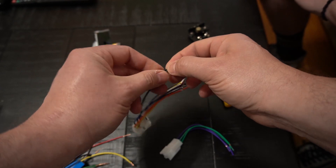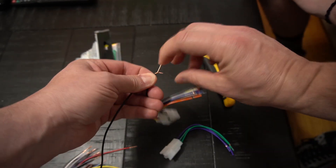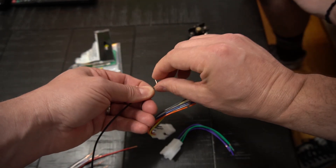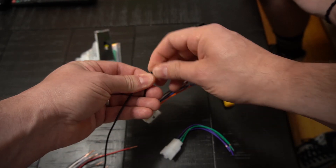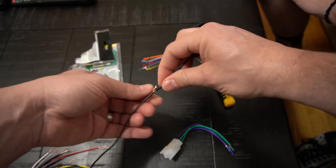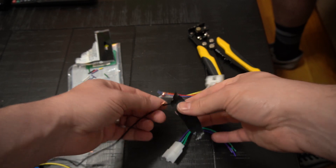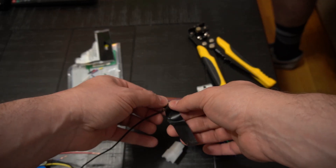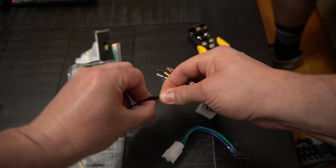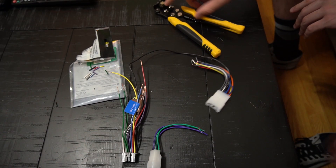Generally I prefer to have them crossed. There's a little bit of extra wire from where we stripped it on the radio harness, but you can just take it and bring it in. Make sure that you have a really good connection, fold the wire over on itself, and then take your electrical tape and wrap it nice and tight. Make sure there's no wire exposed because you do not want these to touch behind your dashboard. Just repeat that process with your other wires and then we'll move on to the actual installation.